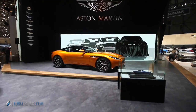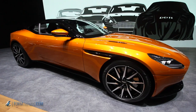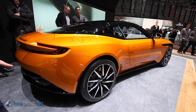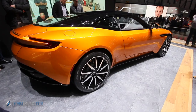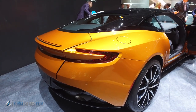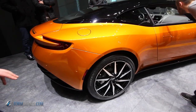In terms of overall proportion of the car, we have a wonderful starting point with the DB9, but we've tried to amplify wherever possible. The front wheel versus the DB9 is now 65 millimetres further forward, meaning we can get the A-pillar shooting straight through the centre of the front wheel. Front overhangs are slightly shorter, rear overhangs about the same. The overall dimensions of the car are very similar to today. We have much crisper lines on the car — we call them very consequential.